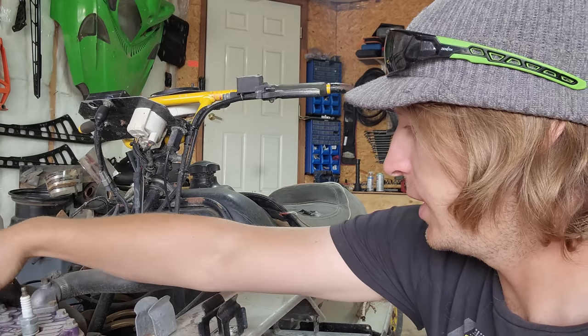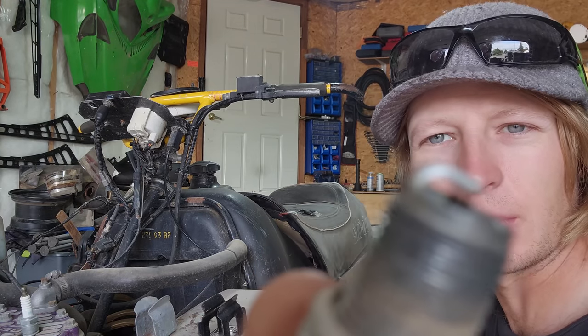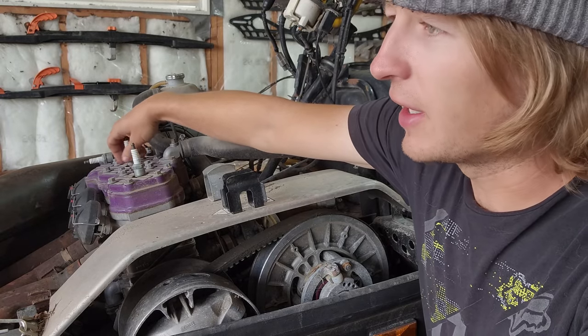The PTO plug looks okay. Middle plug — good again, not seeing any corrosion on it. The mag side one was the one I pulled and it was the one with corrosion on it — it's definitely got a little bit on there. I have a feeling we're going to be taking the head off.